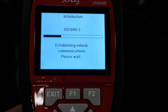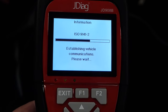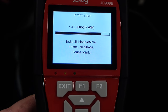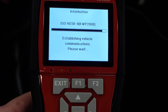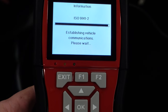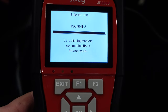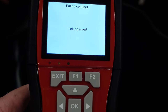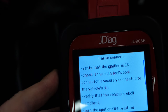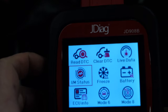Let's see what functions it can do by reading the ECU — it's taking its time. I believe it's reading all the error codes. I'll find out if this gives specific BMW codes or just generic P0 codes; I'm probably expecting P0 codes, but sometimes those are accurate enough to pinpoint faults. As you can see, it's now saying 'link error' — verify the ignition is on. The ignition is on, so it's having problems connecting. We can't seem to get the DTCs.